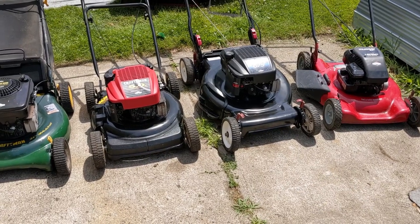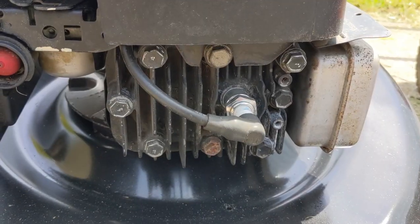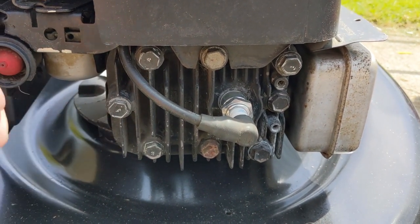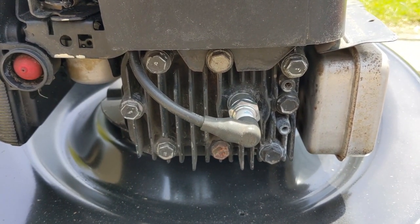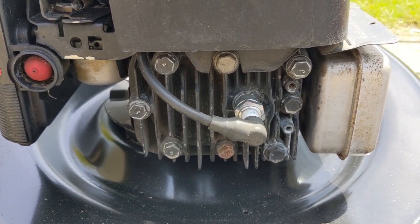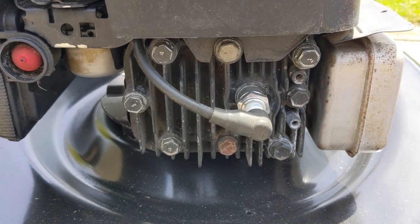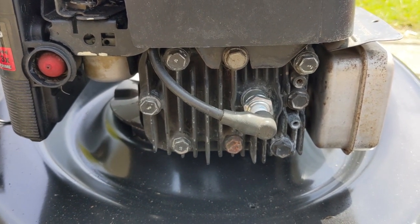They're very reliable. But the one thing you're going to notice on a lot of these lawn mowers is occasionally you'll see a little bit of oil. Sometimes people are going to think they might have a blown out head gasket, when in reality it's just your head bolts that have loosened off and have allowed a little bit of oil — that is normally used to lubricate the valves — to start dripping out where the gap opens up. And if left long enough, those bolts will loosen off to the point where there will be a considerable gap, which will allow combustion from the engine to actually bypass the head gasket and may cause a head gasket blowout where it physically rips out a piece of your head gasket. Then you'll have no choice but to replace the head gasket.